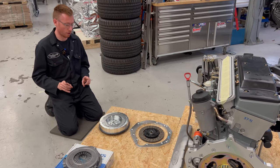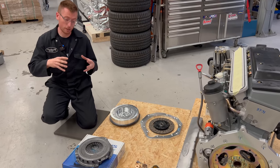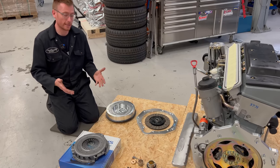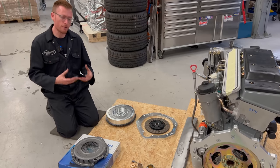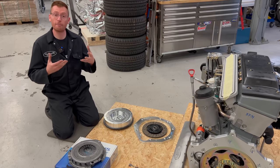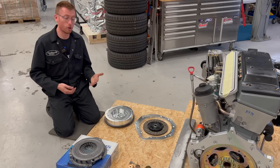Next up in this kit we have the Sachs Performance clutch cover. With some of our kits we offer a slightly lesser spring strength — still Sachs, but not the Sachs Race, just the regular Sachs — which is very good for street applications up to around 350 horsepower. But if you're pushing big horsepower you're going to have the strong clutch, which is 600 horsepower capable. When you have a strong clutch you're going to have a heavy clutch pedal. Clutch boosters are very inexpensive and well worth it — you can have the best of both worlds: strong clutch and a light pedal.